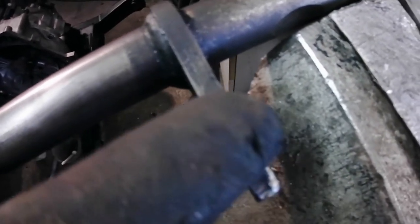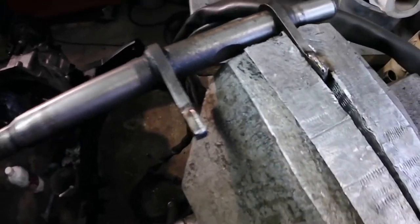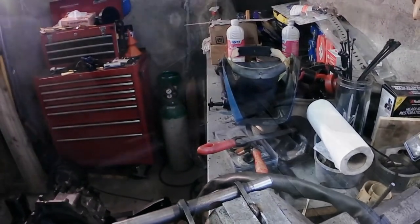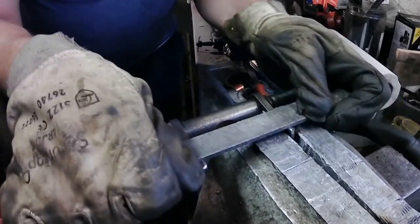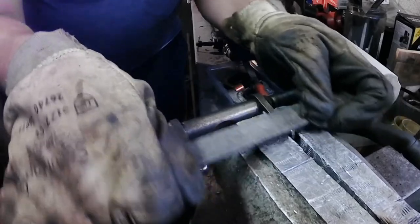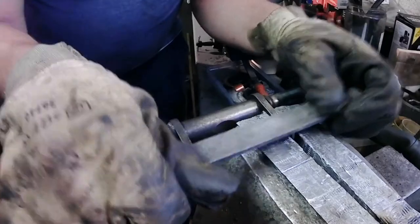Just showing you where we're at — I've run another bead of weld on the inner edges and I'm going to file those flat, and then we're pretty much done. I've got a nice rounded bit. Let me show you the last bit of filing. The technique is called draw filing — you run the file perpendicular to the work, just backwards and forwards. It's not grinding it off sideways — it makes a nice flat surface.